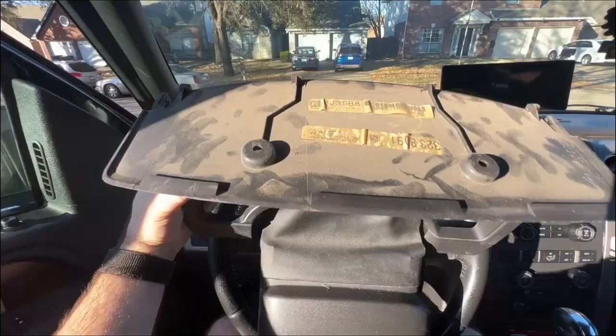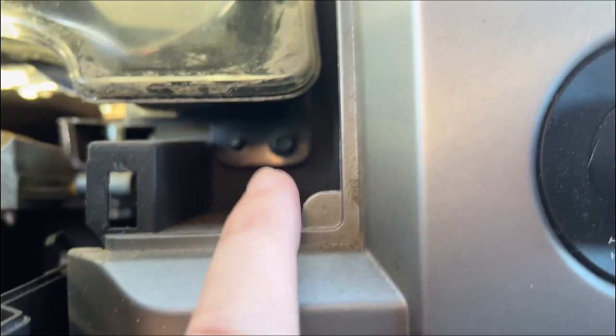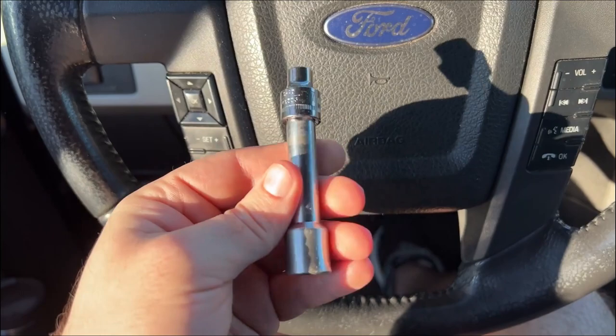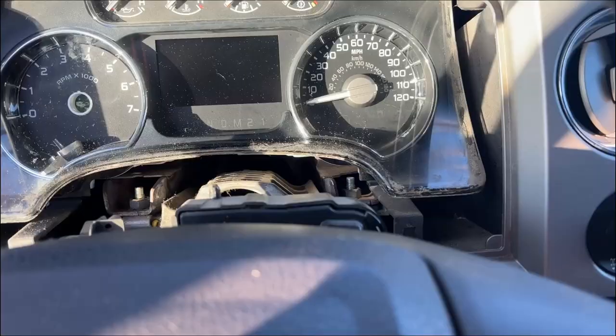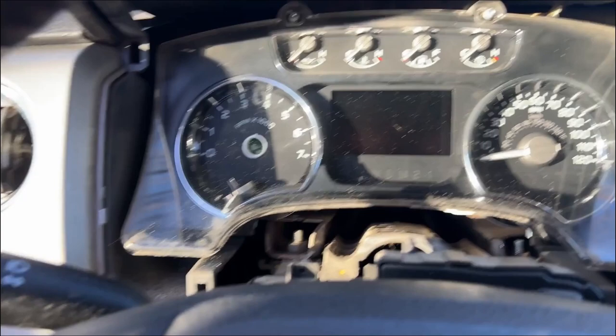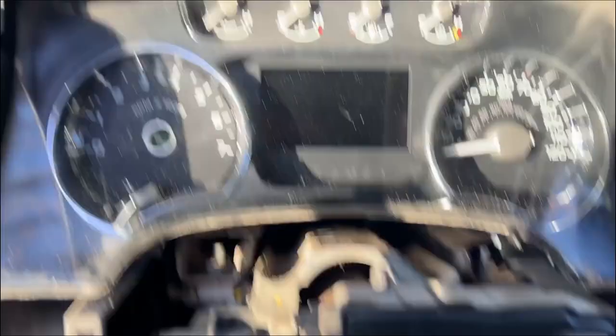Here's the full thing — it just took some finagling to get it out. As you can see the cluster is pretty dirty. Now that we have that trim piece out, we can get to these bolts up here — one, two — and there's one back there that's kind of hard to see. I believe they're all seven millimeters, so I'm going to take those out. I actually needed to pull out the big extension because the one at the bottom back there is a long reach. I'd probably recommend having two hands free because if you drop one of those bolts it could fall into the abyss.